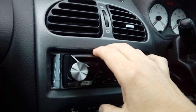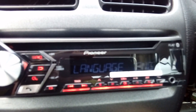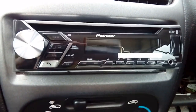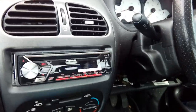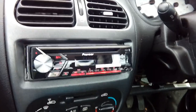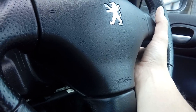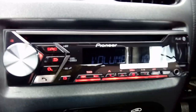Slide the radio into the slot but don't lock it in - leave it ajar and we'll test the radio. Pop your key in, turn the ignition on - hopefully it'll fire up. There you go - it's on. Select your language, set it all up. So it's now working. The car has started because it kicked into economy mode - if you've got a Peugeot you'll know what that is. Radio is working as you can see, and if we test the steering controls...